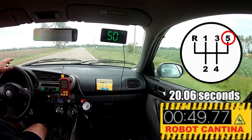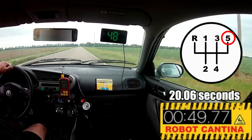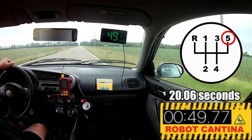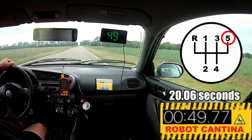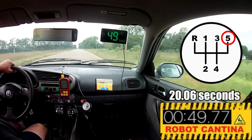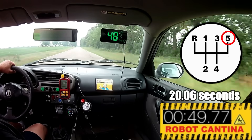Obviously the goal is always to go faster, but keep in mind we now have the ability to make the car go fast or slow with some clever software. The bad news is the fuel rack limiter has to come back out so it can be modified with a longer rod and bench calibrated again. The temporary code tweak works, but it screws up everything else at the same time. I prefer not to rely on a software fix to correct a hardware problem. Off camera, I did verify that the rack limiter will move with the pressure of the governor acting on it.